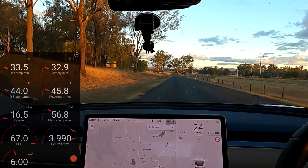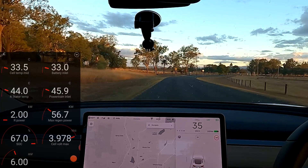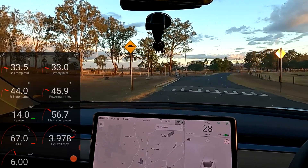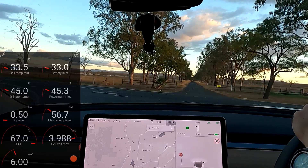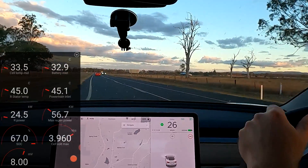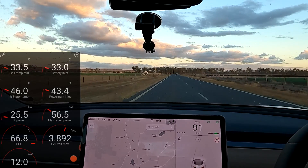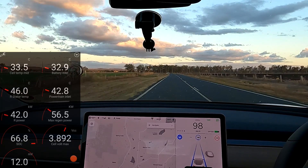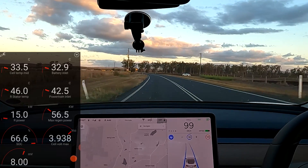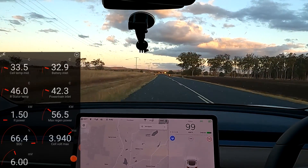I just have to go after this car here. Let's go — one hundred kilometers per hour, autopilot on at one hundred. It's a nice flat road here. I'll just disengage autopilot now and see what we get on maximum regen power. It's off — 30, 40 — we see 50 kilowatts! But now it tapers off: 30, 27. We're getting 50 kilowatts at these speeds. Back in autopilot.